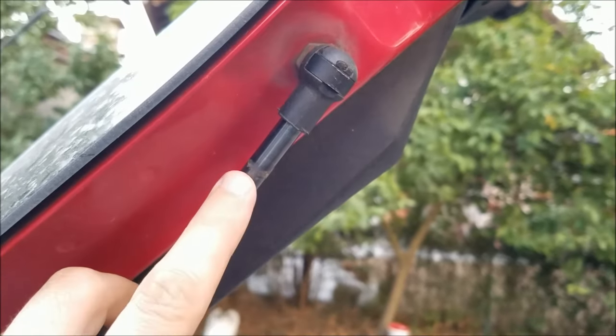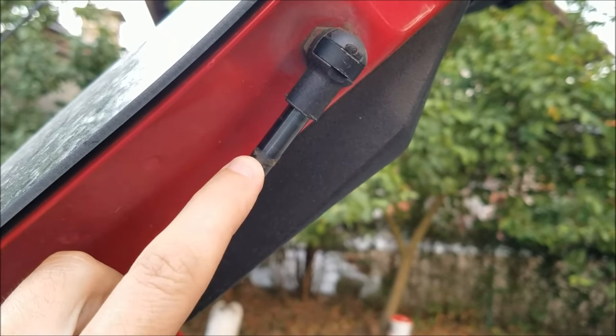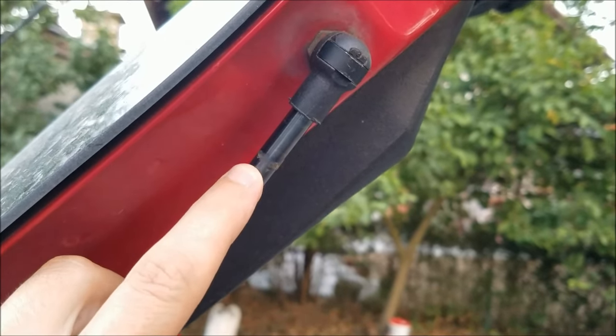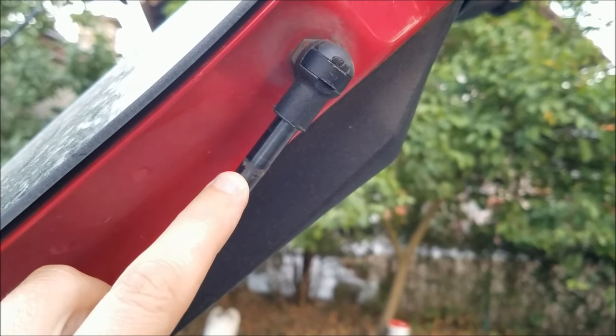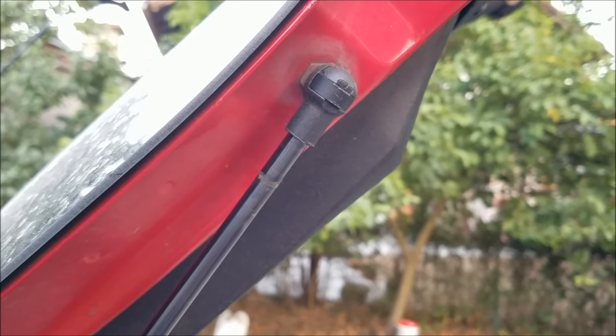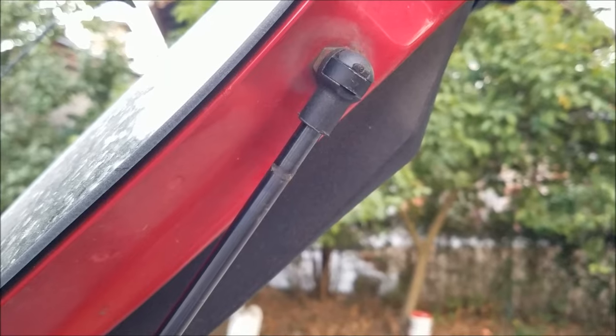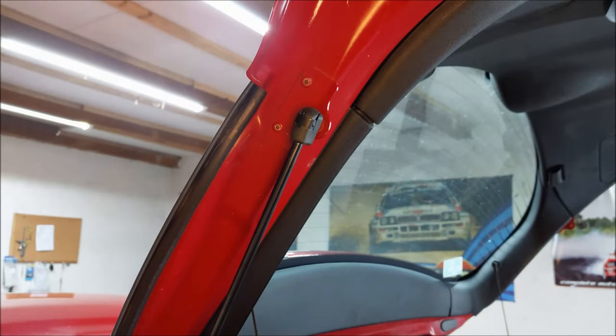This can actually be done on a lot of cars. You can see this line right here — it basically shows us how much room we got when the strut is in the closed position. If you got two or three centimeters of space, that's gonna be enough for you to place the spring. One thing you gotta keep in mind is that your boot lid has to be light enough.